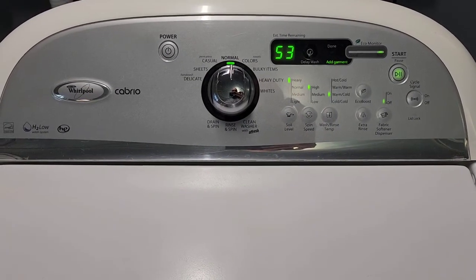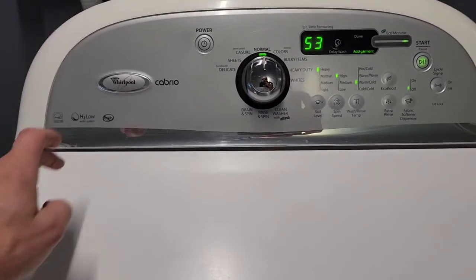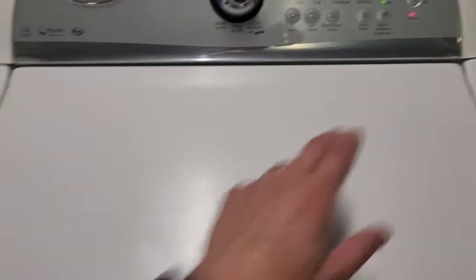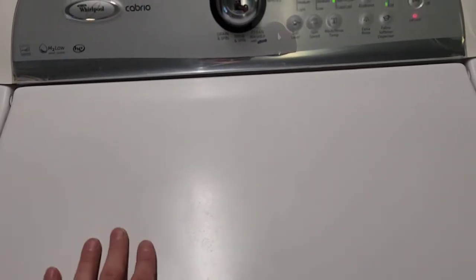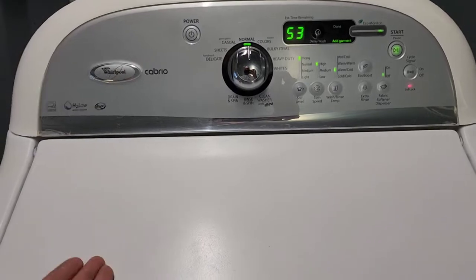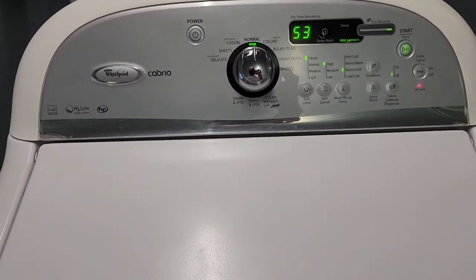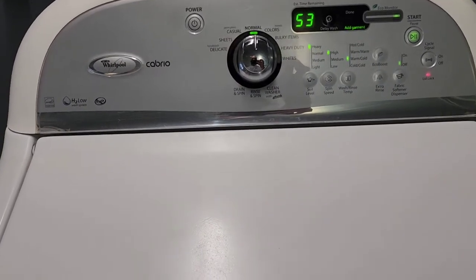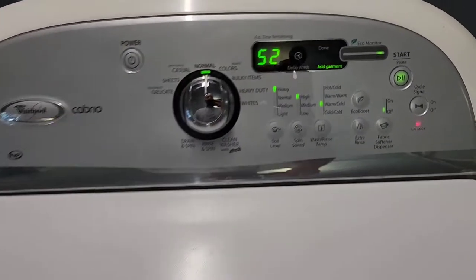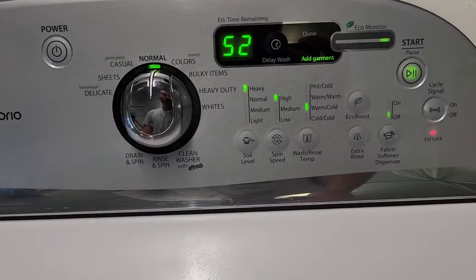And it's gonna get started by running water through. It has 3 spots. You have one for bleach, fabric softener, and your soap. And I should have shown that before we did this here, but that's okay. It'll actually run water through those 3 to get all the soap residue out down into the tub, and then fills the tub up with water. We'll agitate, drain, fill up again with fresh water, agitate on the rinse cycle, drain, and then come back for the final spin cycle. And that's kind of where we're at here.